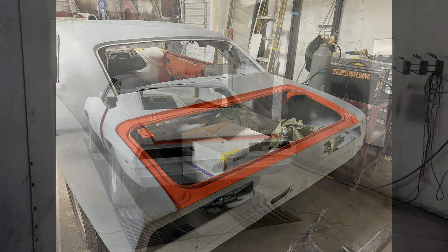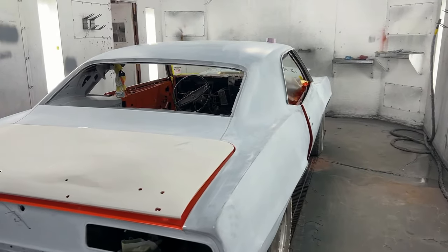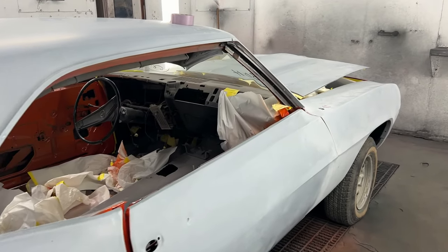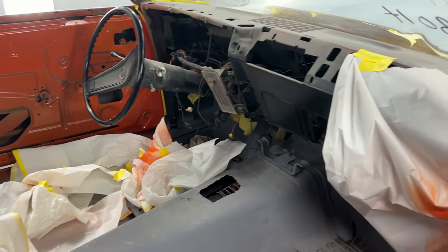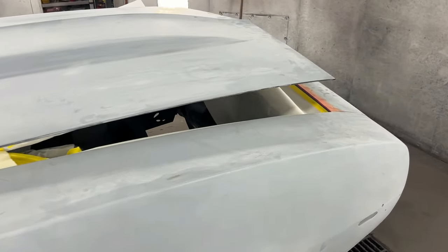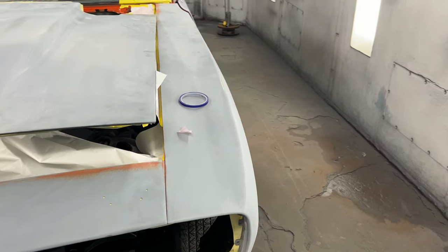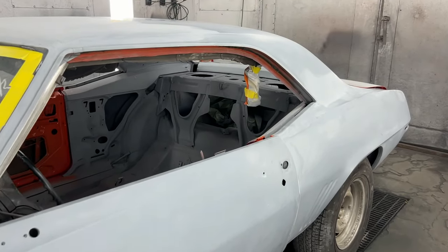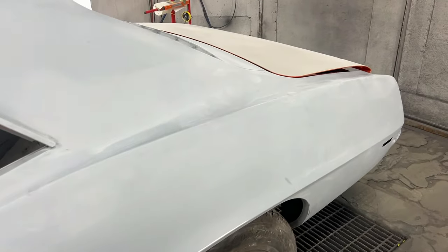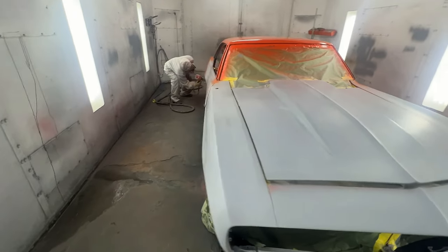Here we've jammed the areas, then installed the hood, trunk lid, and doors. The car goes in for the final prep. Unlike the Cuda — where we lined everything up and permanently attached all the fenders — on this car we just loosely installed the front end to paint it, so that the paint lays naturally where those body panels are going to be. Then we're going to remove the front end of the car so that I have access to the subframe to rebuild the suspension and install the engine, and then reassemble everything afterwards.